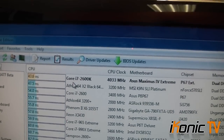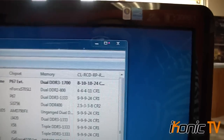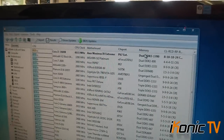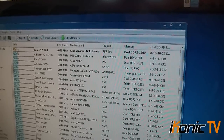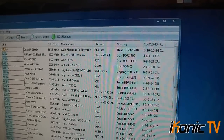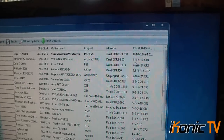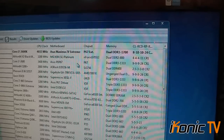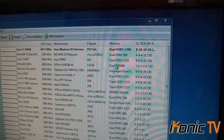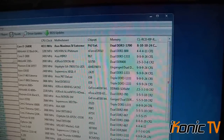It's got a latency of 43.6 nanoseconds. I'm running the memory at DDR3-1700, so I have overclocked it, and the processor is running at 4GHz. One below that is a very old board — one of the older Athlon 64 X2s — and it's got 47.5 nanoseconds. You might wonder how an old build like that gets that result. Well, if we go to its timings, it's got 4-4-4-11 — it's DDR2-800 memory, but the timings are very fast. What this shows is that today's DDR3 memory, even though the timings are more than double, because of the higher megahertz, is a lot faster overall.